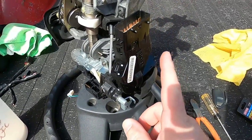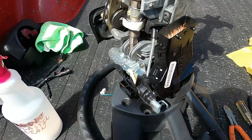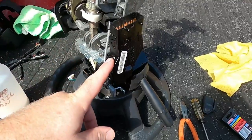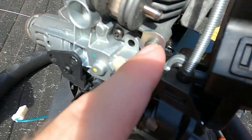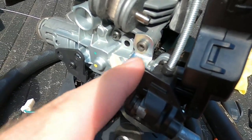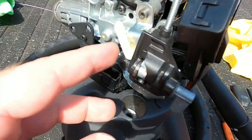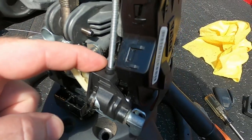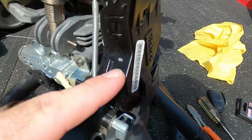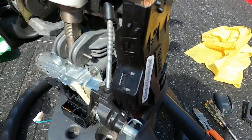The one thing I am going to replace is the ignition module, because I did buy a new one, and I might as well swap it out while I'm in here because you got to take this bracket off. It's a Torx fitting, and then the screws are two different sizes, so be careful when you're taking it out. Pay attention to where they came out. There's two of them, and then you can pull the ignition module out of there.